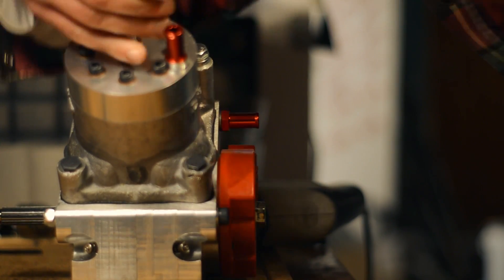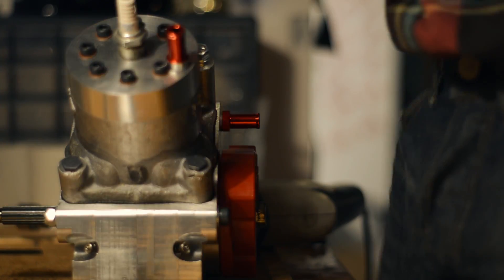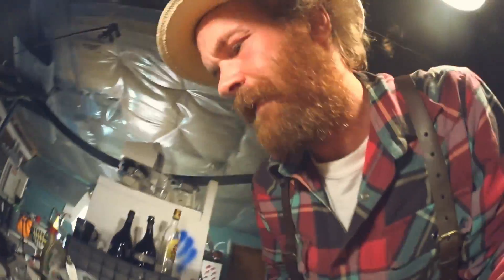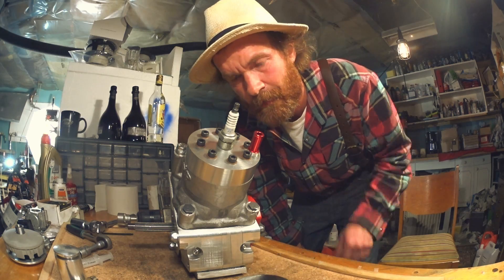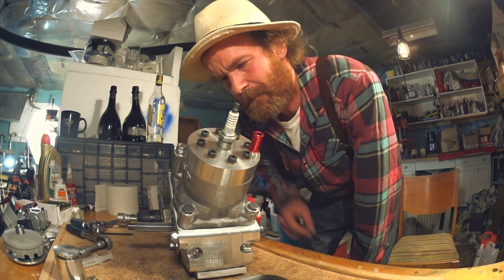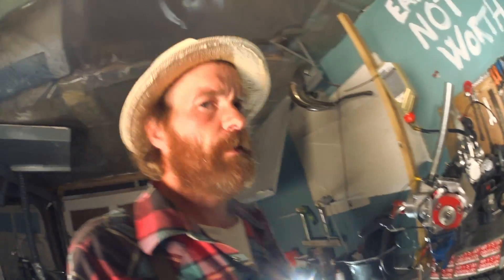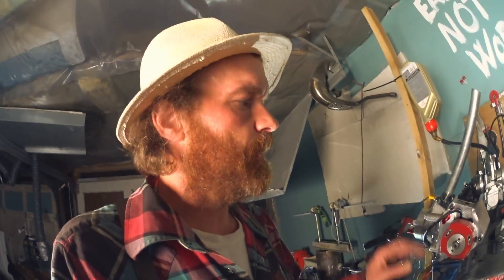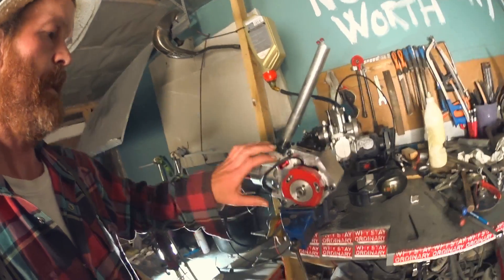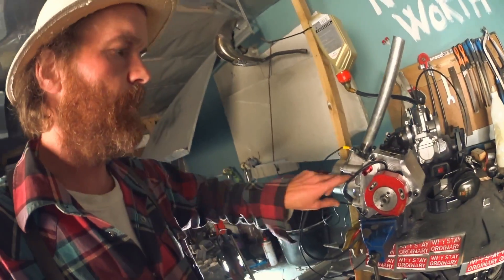Still not as good as what I'm used to seeing, so the ring is probably not sealing as good as a normal ring — the new one should. It takes a lot more force now than it did last time. Someone also commented that it might be smart to have it oriented like it's mounted in my land speed bike, which is upside down. The reason being that gas will fall out of suspension in the air inside the crankcase because of the large volume and low turbulence in there, and just stay in the case versus falling into the cylinder. That makes sense, but we'll try it like this first.